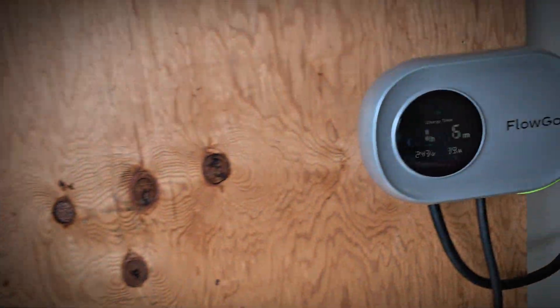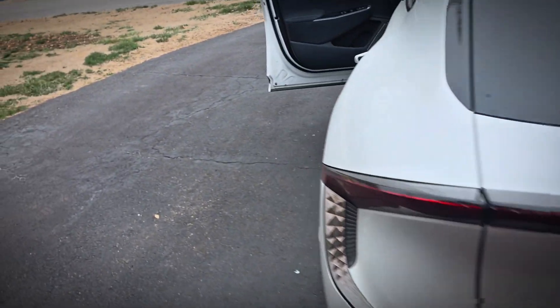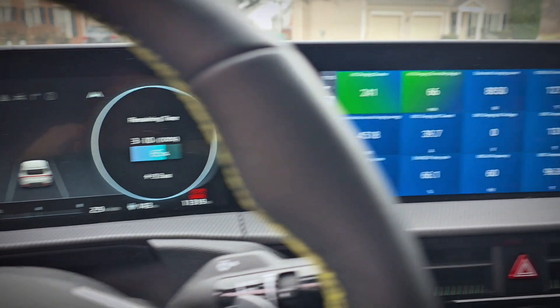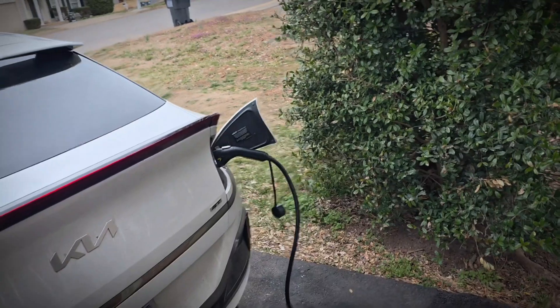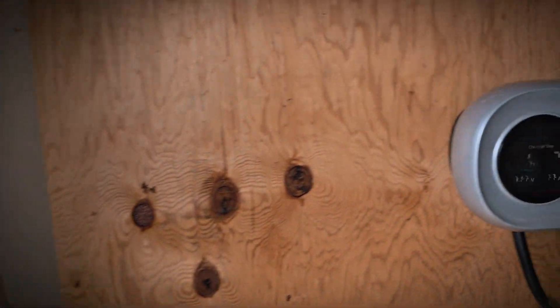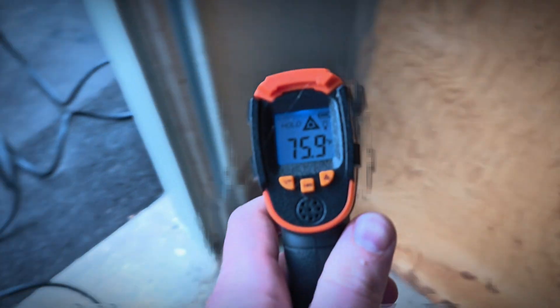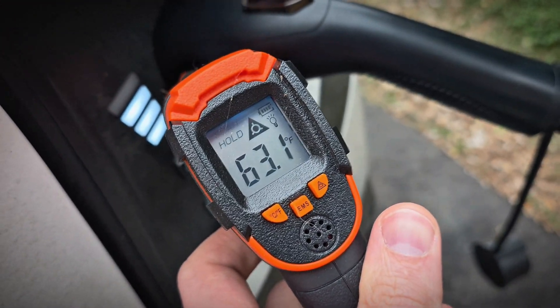It's been a little over an hour now. The display shows one hour six minutes and still going strong. Looking inside, we're still at 9.3 kilowatts. The charge port temperatures are only around 127 degrees Fahrenheit, so that's good. Coming around here, we'll go ahead and measure the temperatures using the infrared thermometer. There are definitely increases from where we started, but it's not hot by any means. Overall, I'm happy with it.